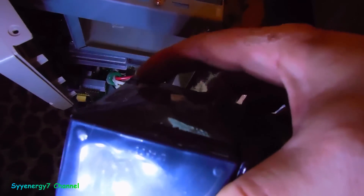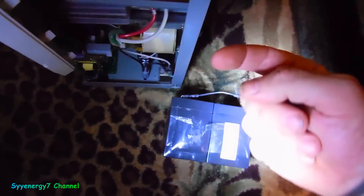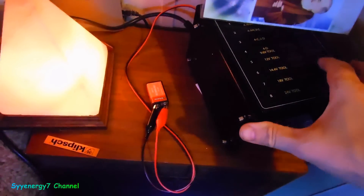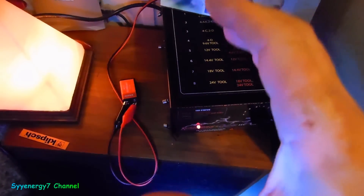I just want to warn you that if you see battery sides bowed out like this, I had a hard time pulling it out of here. I would not try to mess around with something like that. There's a button in the back of that charger right back here — that red button. You can hold that in and that'll give it a manual charge and get like one volt going. But I don't even want to mess with that because I figure that battery's damaged.